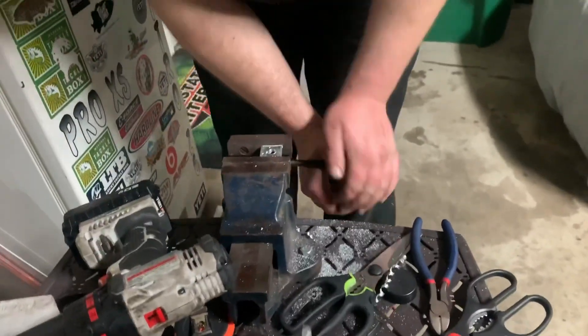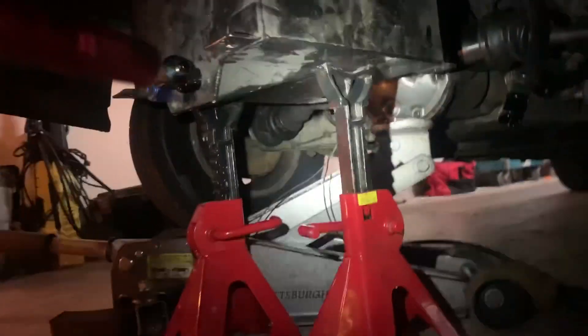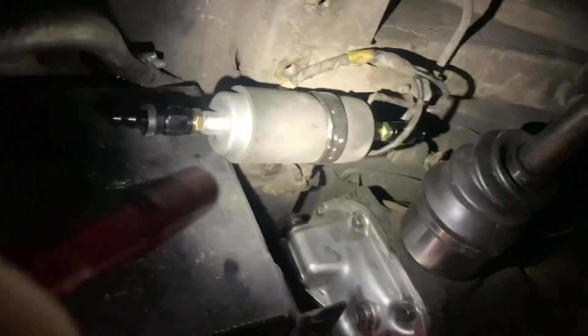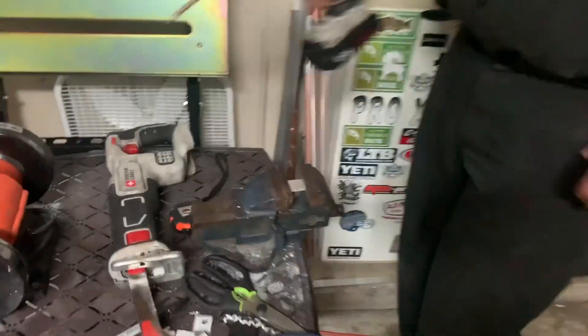Fabbing up some straps to hold our fuel cell — Matt's working on that and I've got the fuel cell perfectly positioned. You can actually get to the filler hole pretty easily from there. I just got it up on jack stands right now, took measurements. I got a rivnut here and a rivnut there, and I made the decision to install the rivnuts from the top so we don't have little nubs sticking up in the hatch. The strap's just going to bottom out on the stub instead of sitting flush but that won't be a problem — it keeps everything on top nice and smooth.